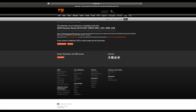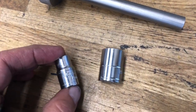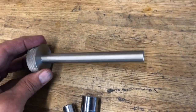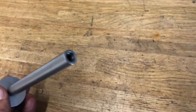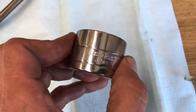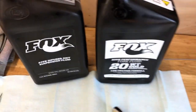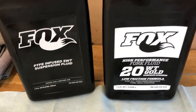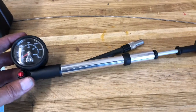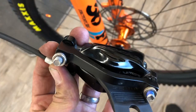There's a little identification code on the back of the shock and you can type that into Fox's tech support. Unfortunately there wasn't any information available but we'll work around that. Tools needed: a 10 and a 15 millimeter socket, a lower shaft release tool, a big 32 millimeter socket for the air cap, some PTFE infused 5 weight oil, 20 weight gold Fox oil, and definitely a shock pump.